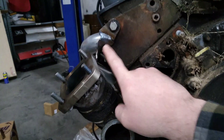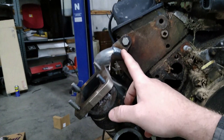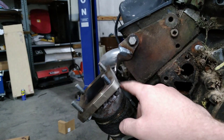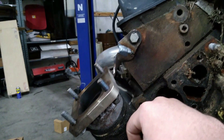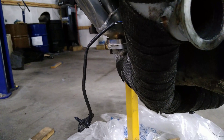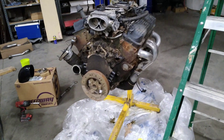I just re-welded the brace because it actually broke in half on the car — it had been cut once before since it never really lined up that good. I had it originally cut in half and welded but didn't have good access because it was in the car. Now it's welded pretty solid and that should not break. We'll probably paint that eventually, but for now it's solid. I'll go ahead and cut the three-bolt flanges off — I'll probably save those for something else. The only thing I have to do is swap sides with the headers because this one is the driver-side header since I've beat it to clear the steering, so I'll swap them so my adjustments will still work.